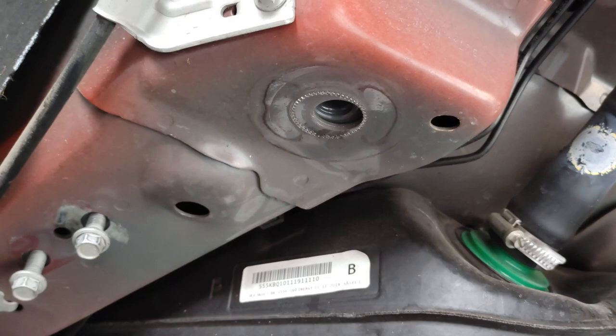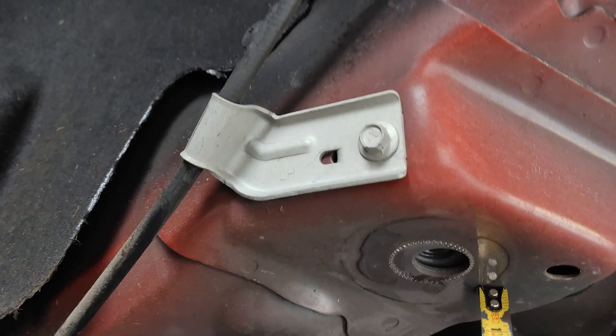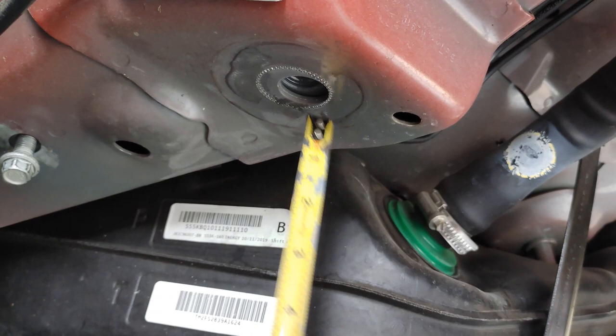As I mentioned earlier, here's the front mounting point. On all four corners you want to measure from the chassis and have the threads come out four and a half inches. Once you thread them in, just hold the tape measure up - four and a half inches - and then you can install everything.